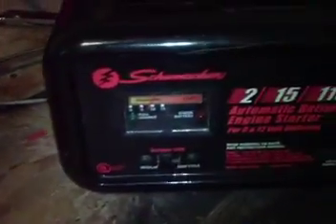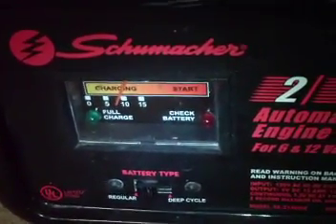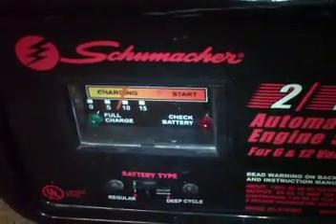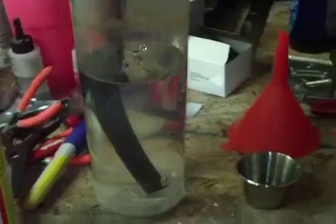Ultimately, this particular setup will produce around a liter a minute with just an eighth of a teaspoon of sodium hydroxide in tap water, pulling just below 15 amps. If I add a little more sodium hydroxide, I pull more amperage, the water heats up a little more, and I produce more hydrogen — there are good and bad things about that, as some vehicles don't need that much hydrogen.